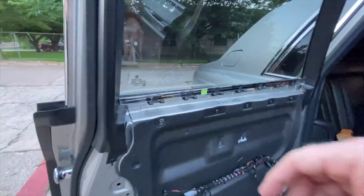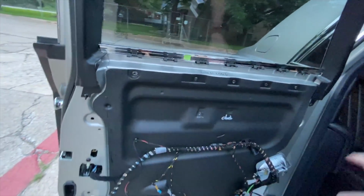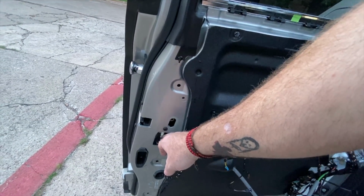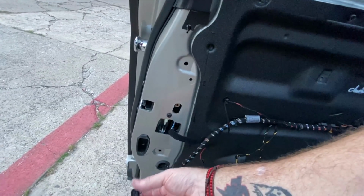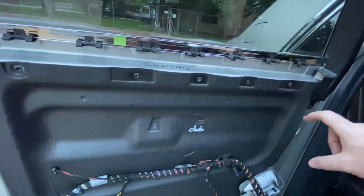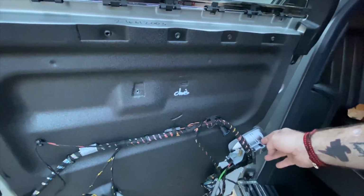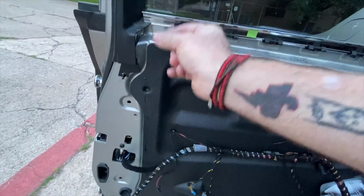So yeah, they seal this in. This is all glued in, and for sound deadening. And you have an electronic module here that releases this. This connects to the open and close pushy button. Then these run to the lighting that go up into the door panels, because you have like a strip of light that runs in here. Then this is the door handle. And then there's a rod that comes up here for the physical locking it, which is worthless because you can't.